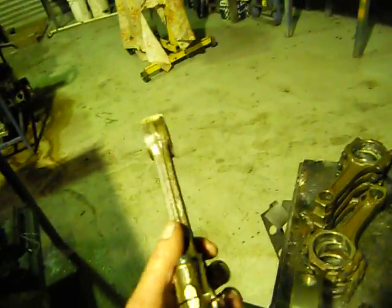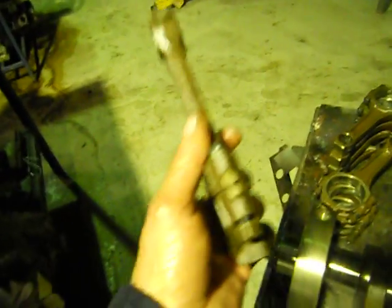The con rods and pistons have been pressed off the rods. Before you knock your pistons out of your block, always number them. Get in there and number your rods and the caps - don't mix them up.